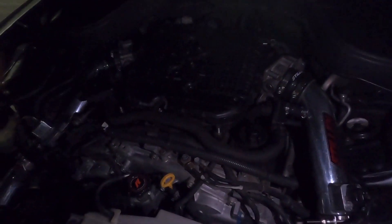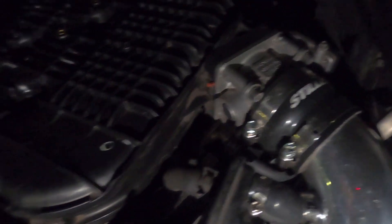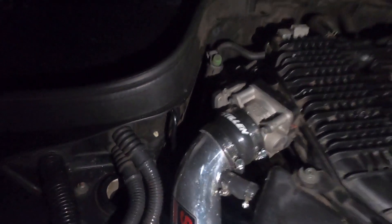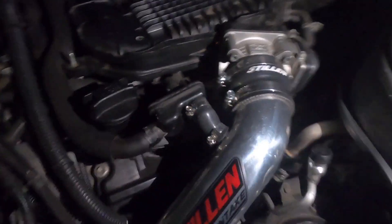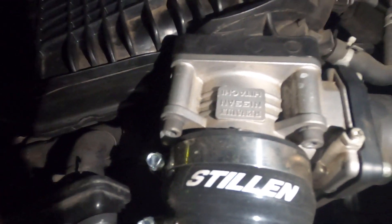What I mean by torque — let me pop the hood and show you guys something real quick. For those of you that don't know what torque is, I'll explain it as best I can. Underneath the engine bay — see these things right here? These are your throttle bodies. If you have a VQ35 or VQ37, the HR or VHR, you're going to have two throttle bodies. If you have the DE version of the G35 or the Rev Up, you're going to have one throttle body. Pretty much what the Sprint Booster does is open up that throttle body — that butterfly valve right there.